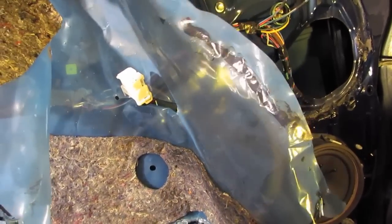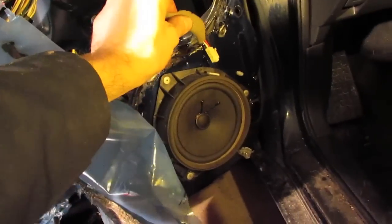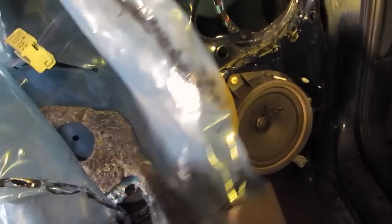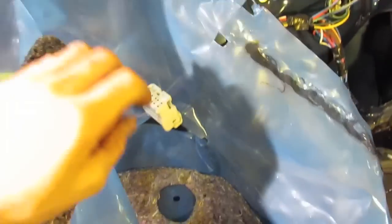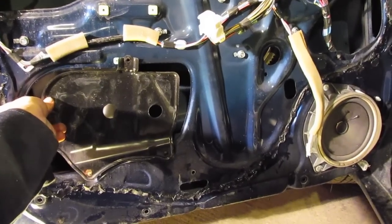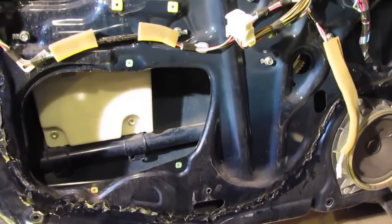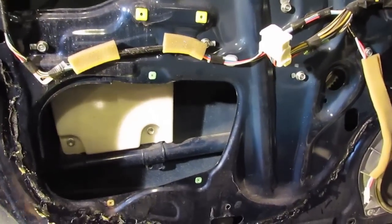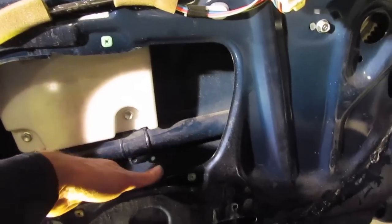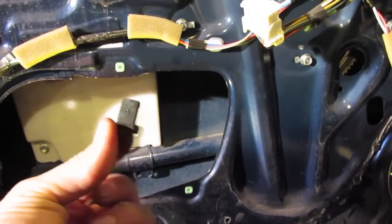If you pull it slow enough you'll actually be able to reuse most of the adhesive. With the vapor barrier completely loose, the next step is to detach any necessary wires such as your speaker, noting where they are located. Once you get that done you have to slide it off the door handle and finish removing it around any wiring. With the door exposed, I've removed three Phillips screws which removes this panel right here — they used Phillips screws so it's a pretty common tool. I've already reached in and pulled out the plastic piece which we need to glue back to the handle.